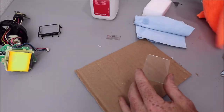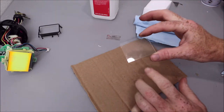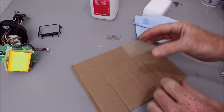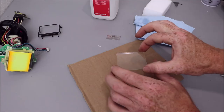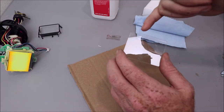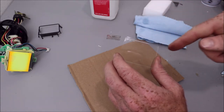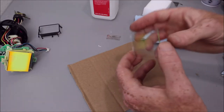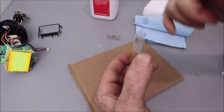you're going to need to cut your polarized linear film to go one piece on the front and then one piece on the back. And you can either just lay this on top of your polarizing film and trace it and cut it. Just need to make sure that you don't cover up this edge where that rubber contacts connect the LCD to the main board there. And you can see, I guess from the side profile, that there's like a lip there. Hopefully you can see that.